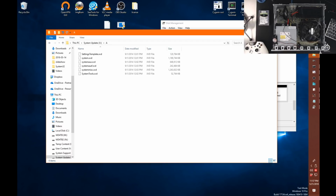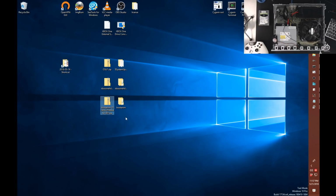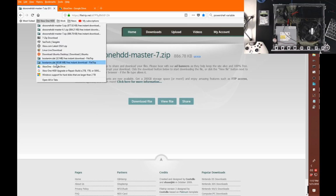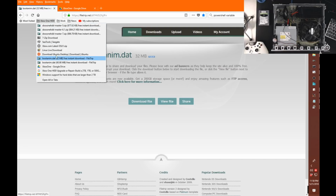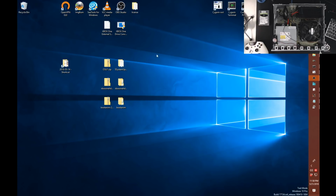So I mentioned earlier, we can close our disk management, but you can see here's our disk 3. I mentioned earlier about downloading the boot anim files, and again, there's links in the description, but that can be done by using any of my links here. So in this case, we're going to use the 32-bit version because we're dealing with an Xbox One OG model, although I guess for fun we could download the other one instead, which is the 60 megabyte option here.